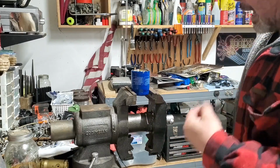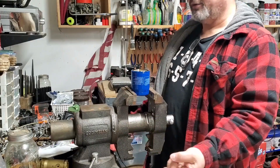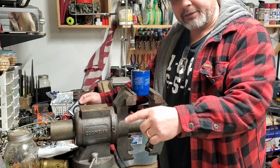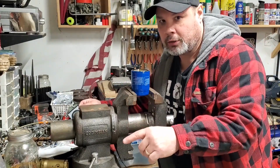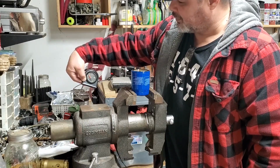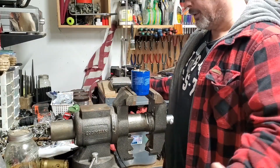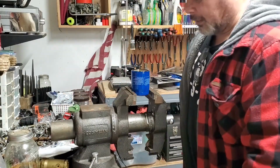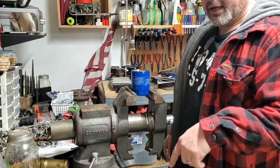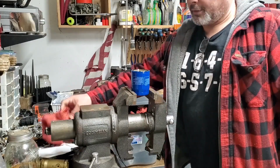And my idle oil pressure indicated at the VTEC on the discharge side, and I'll get to that in a minute, when I said VTEC oil pressure at an idle, it showed a little scratch more than 15 on this gauge. And like I said, I never even put an oil pressure gauge on it because I wasn't having any indication. The engine's quiet as a mouse. So next oil change, which I did an oil change, that's the reason why this is here, I'm going to check oil pressure on it.